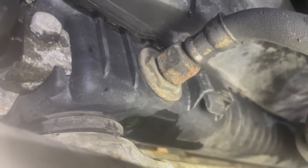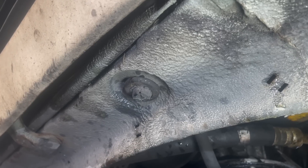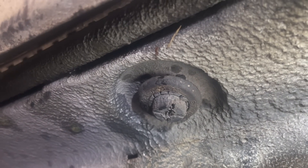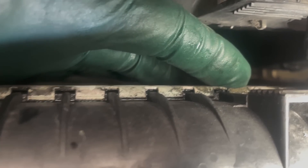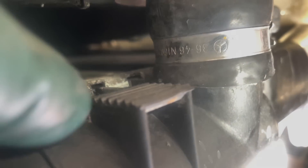So it looks like this one may be coming from a leaking radiator. I'm going to have to pull that shroud back and take a closer look. I was kind of hoping it was a radiator drain plug, but that looks pretty dry. I think the seal needs replacing though. Looking down here, it doesn't look like this is going to be an easy fix. The core is all wet on this left rear section, and I'm seeing wetness on the crimp to the upper tank. I thought maybe it was a clamp, but looking underneath the hose there's no wetness — so it's coming out of the top, maybe leaking down the core and dripping out the bottom.